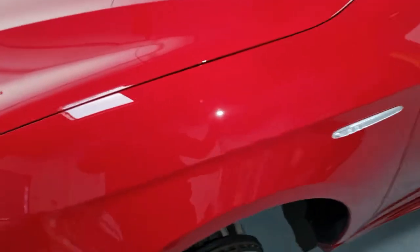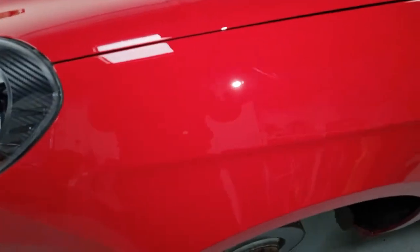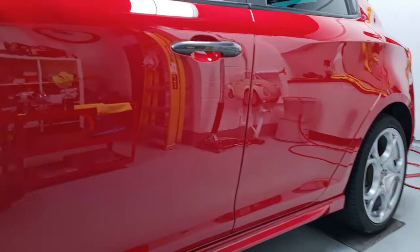So it's had its polishing stages, cut, refined, went back, cut the bonnet again, refined, panel wipe, and then always I wipe down with WaxedShine panel wipe. Oh, look, it's backwards. Can you read backwards? Yeah. So here's the polished and coated. Still some deep scratches in it, but they're too deep. Tried sanding a couple, but they're just too deep to come out. All that hazing's gone. The majority of the scratches are taken out and anything's rounded off, so without the light, it just looks great.